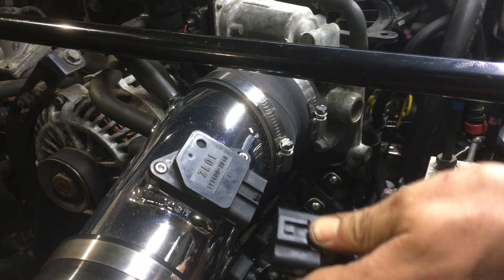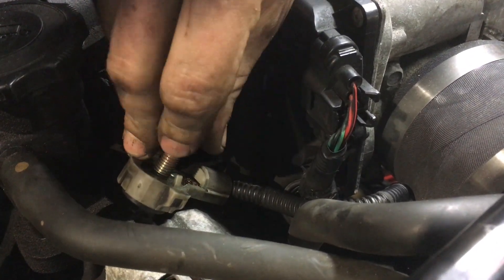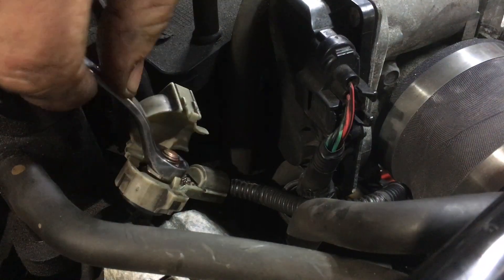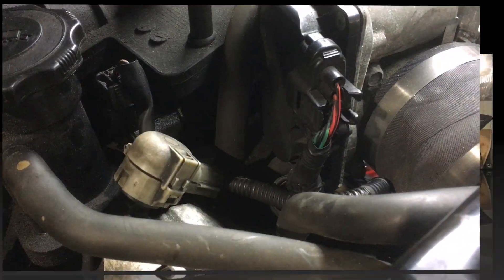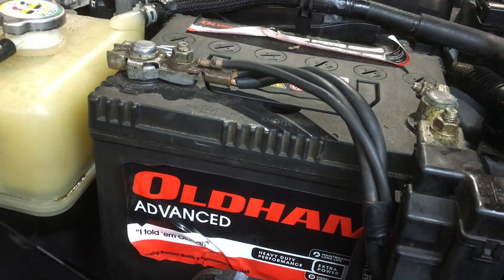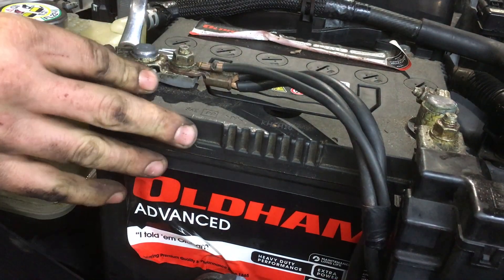Just reconnect your MAF sensor. We're going to hook the earth cable back up — thread it back through where it came from, there's a nut on there, use the nut and keep your spanner, lift it up, flip it down, done. Reconnect the battery — push it down and tighten that up nicely. Get no wobble and you're good to go. All that's left to do now is fire the car up and reset the ECU. We'll be doing another video on resetting the ECU later on the channel, but for now I'll put a technical article about it down in the description.